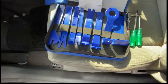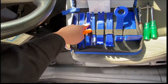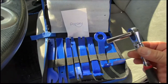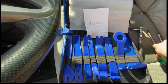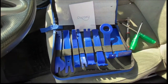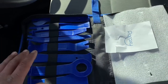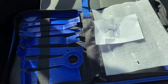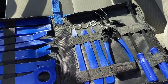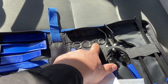All the tools I used for this 2010 Honda Civic were: this plastic trim tool, a quarter-inch ratchet with an eight millimeter socket, a Phillips screwdriver, and a flat head — that's it for removing all these plastic panels. This plastic trim tool kit is perfect for interior work. You can see there are pliers, tools to remove clips, stereos, connector pins, and all that.